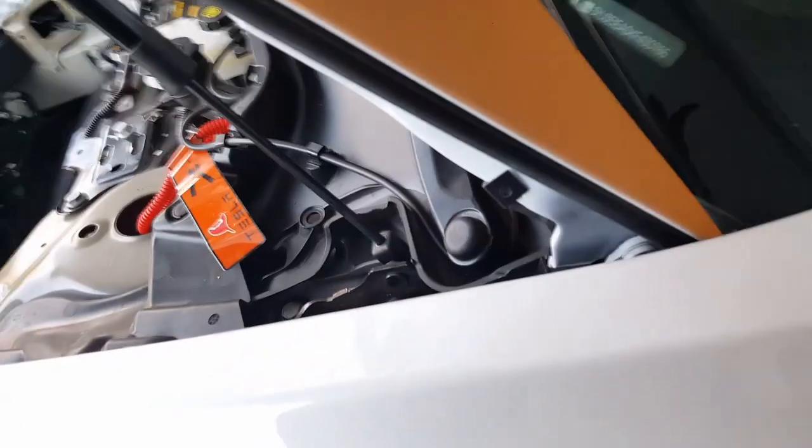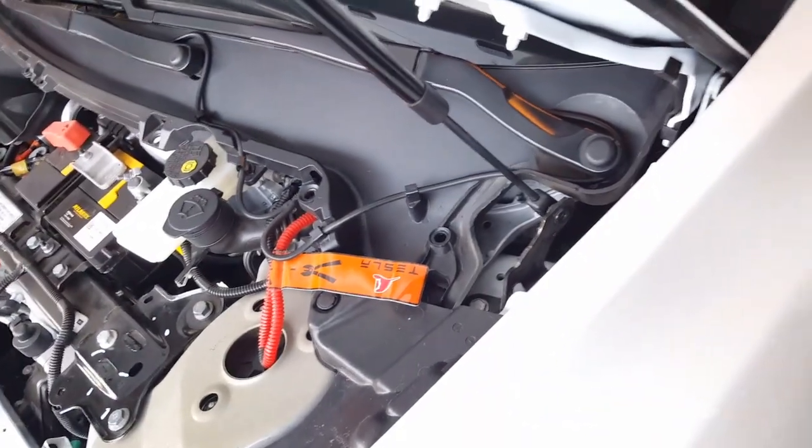You can see here, I can't just get enough of this guy. You can see the edges here. Look at that. Beautiful, right? You can't even tell. Let me close this. Look at the edges here. That's a good PPF right there. There's no jagged edge showing. There's no exposed edge showing right there. A lot of places cut almost a centimeter right there, exposing the edge, because they can't stabilize the PPF, because PPF tends to always want to go flat, but a professional one could make it happen for you and keep it staying.